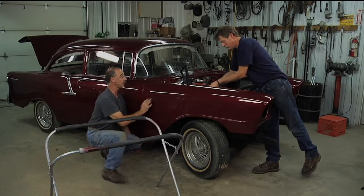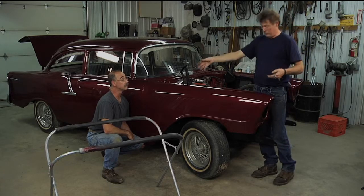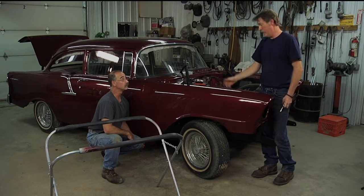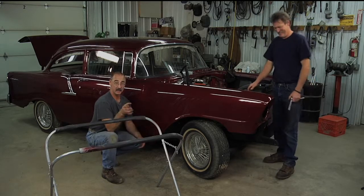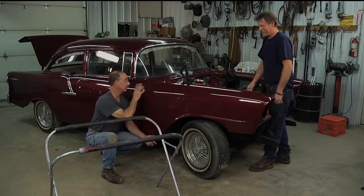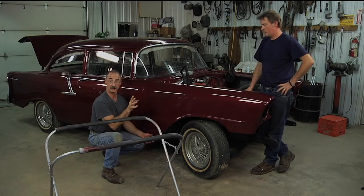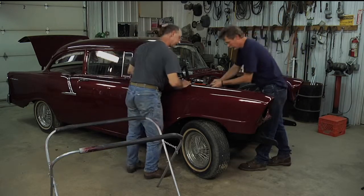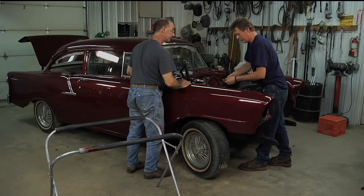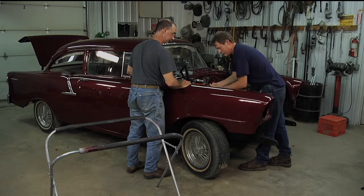Really Brent, this one went on really well. Yeah, sometimes you've got to shim the front, shim the bottom — but this one did actually go on really well, so we got lucky. On your particular vehicle, be patient, use the shims as needed, take time to get everything aligned just right, and the car's going to look great when you're done. What do you got left to do? Just tighten up two bolts here, and then we've got to put a couple in underneath the fender on the inside. Good to go.